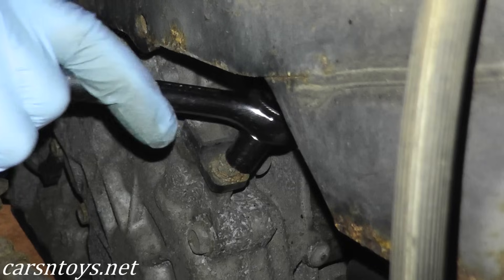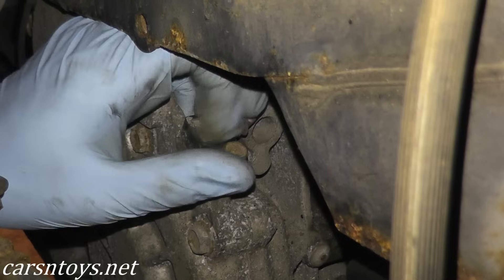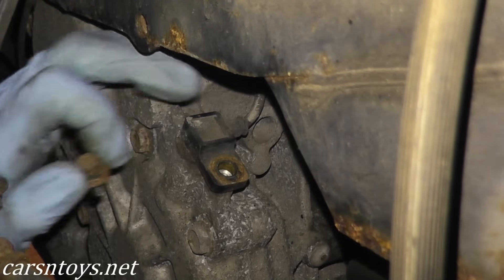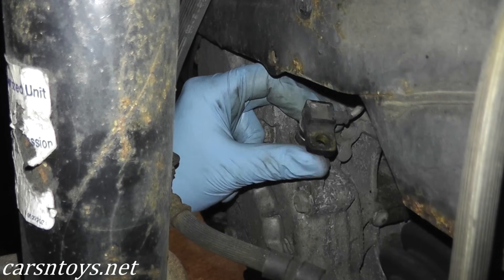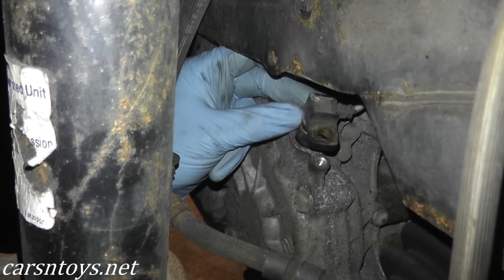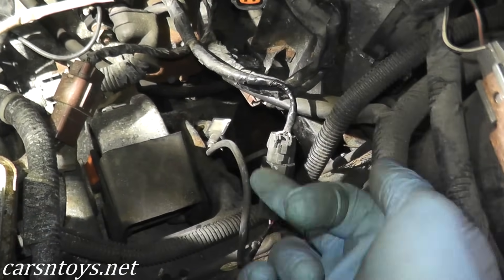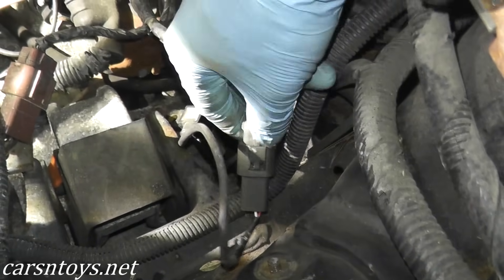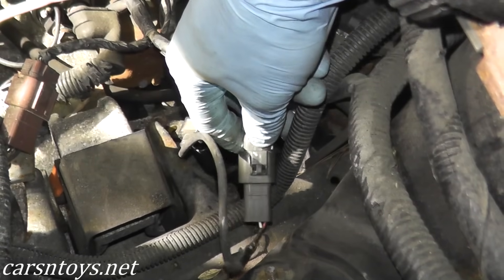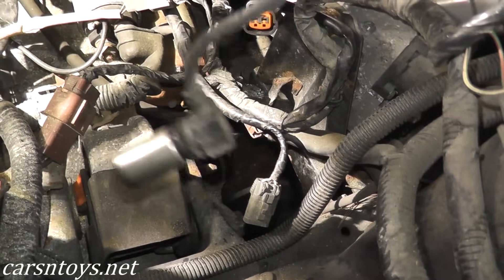There's an O-ring on this sensor, so just keep twisting and pushing up. The O-ring is right here, which makes a very nice seal — and there's your sensor. The harness connector for this sensor is up in the engine bay; I followed the wire up and this is where the connection lives. I've already disconnected it, but that's all you need to do.